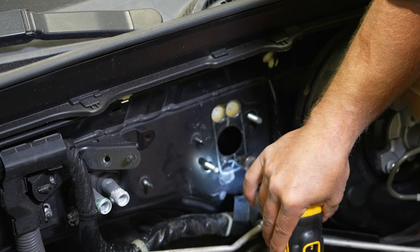The other thing is check your pin fitting. So this factory pin from your clutch pedal is gonna go through this clevis here. It's a pretty tight fit. It's gonna be snug. So what I would recommend, make sure it goes in and out easy enough, but you don't want it loose. If you do need to open it up just a tiny bit, a 5/16 drill bit will knock any burrs off or whatever it might be. Even just the plating, it's such a tight fit that different coatings or the thickness of this plating can make it inconsistent. But either way, check that now. It's much easier to do it prior to getting under the dash, going to hook this thing up. So that'll make your life a lot easier during this install.